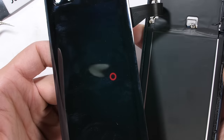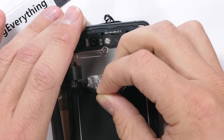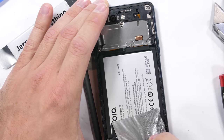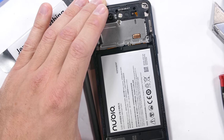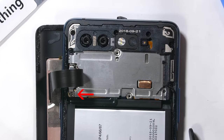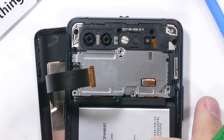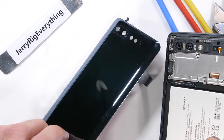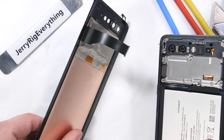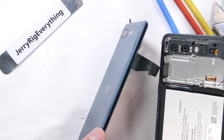We'll put the patient back to sleep again and see what else is inside the phone. Normally I try to disconnect the battery first so there's no power running through the device, but everything is still hidden under this large black sticker and also screwed in under the top metal plate, so I'll risk it. Unscrewing the little silver latch over the rear AMOLED connector and popping it off with my plastic pry tool — just like a little Lego. A clear phone definitely won't be possible this time around; trying to remove a display panel that's glued to glass is like brain surgery on a potato chip. Something is going to crack, so I'll be leaving it alone.